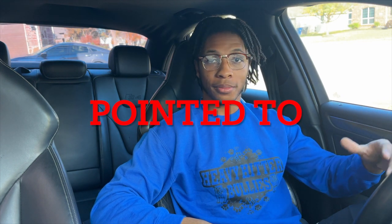And I don't want this video to be too insanely long, but I'm trying to catch you guys up to where everything's at right now. So I took it to Blair Automotive. They later told me that they did the transmission tune, they did the engine tune. You can finally rev the engine, but what they told me was the car wouldn't drive. Pretty much you put it into gear, the car will roll forward, put your foot on the throttle, and it wouldn't go anywhere. What they found was that the gear selector too had malfunctioned, and this pretty much led to a faulty Mechatronic.